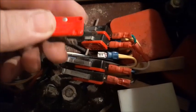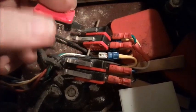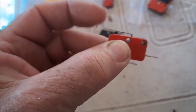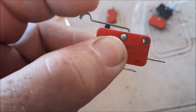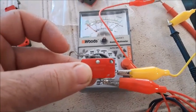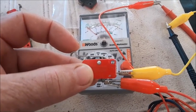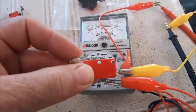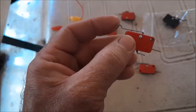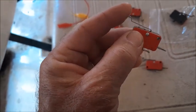On my cart there are just two clips that pull off of each micro switch — there are some that actually have three clips. When you push the arm down you can actually hear the button click. By setting your volt meter to ohms and then hooking up both prongs to the micro switch, when you push the lever on the micro switch you'll read ohms every time, and this will tell you the micro switch is good. Sometimes when the micro switch has actually gone bad you can notice that the button doesn't even pop out of the housing.